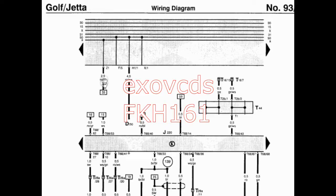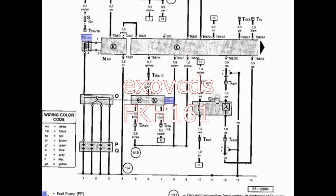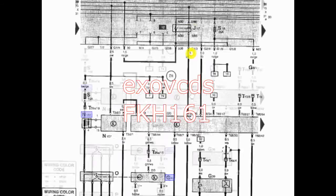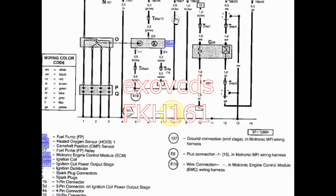The red/blue wire is the same wire. Scrolling up, it enters the fuse box at Z1 and connects to point A. To find where A goes, scroll across to the side — continuing along A, it meets up with S18, fuse 18, which should be the fuel pump fuse. Continuing to the left, here's J17, which is the fuel pump relay.